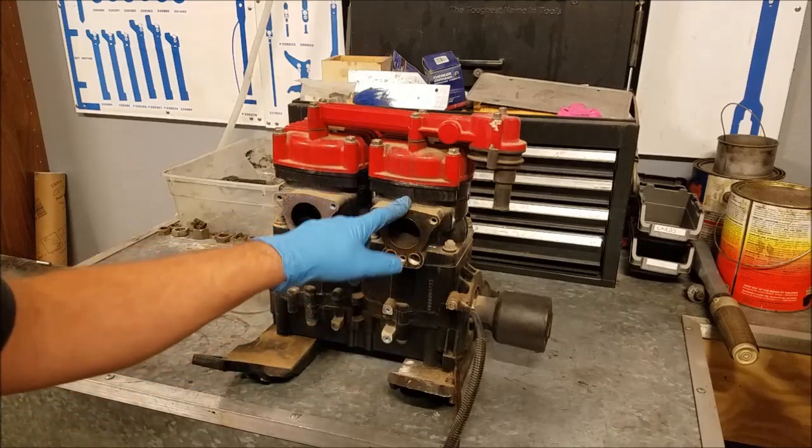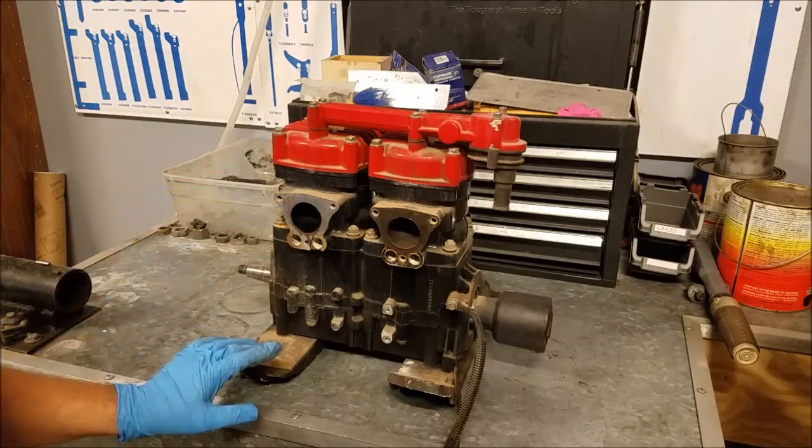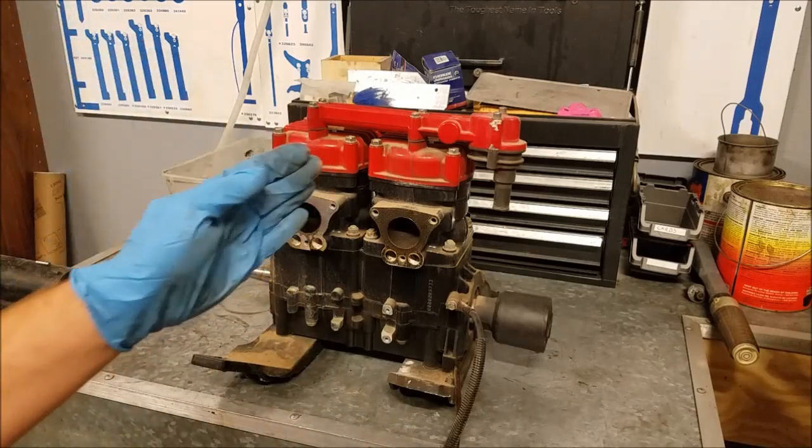The rear cylinder has zero PSI. The front cylinder has 120. I see that problem a lot on forum posts — 'hey, I just got an outboard, did a compression check, one has zero, is that an easy fix?' Most of the time, absolutely not. The engine's screwed up. You might get lucky sometimes, but with zero PSI — nothing coming out of the compression gauge — most of the time this thing is toast.